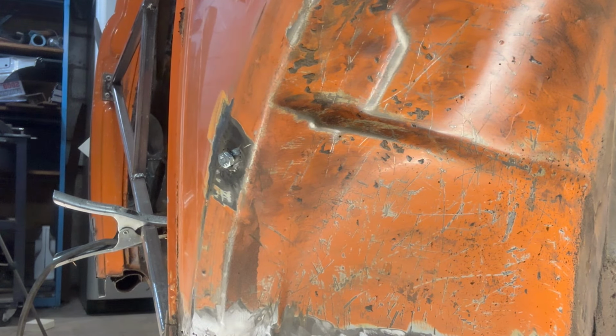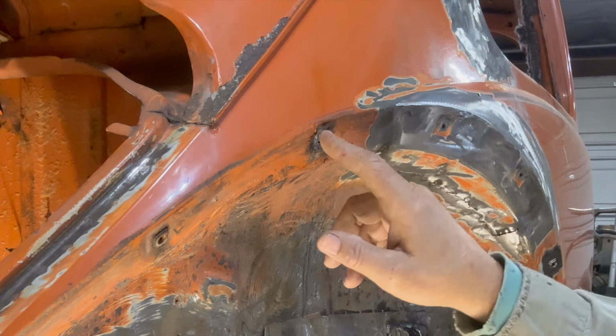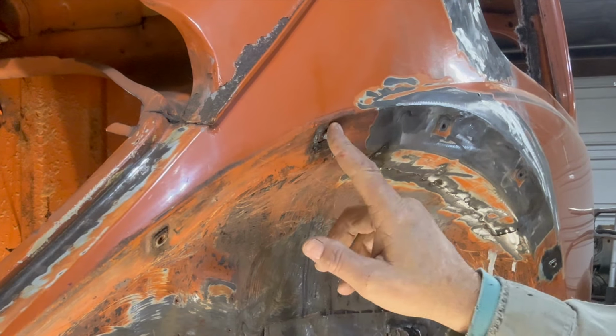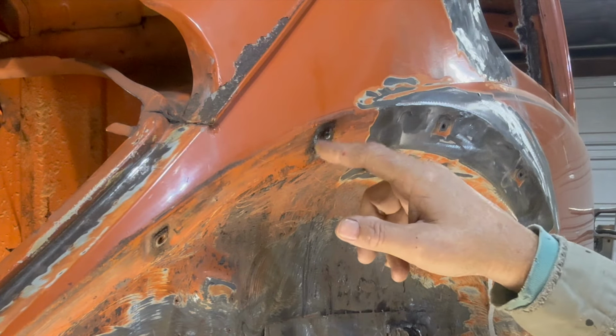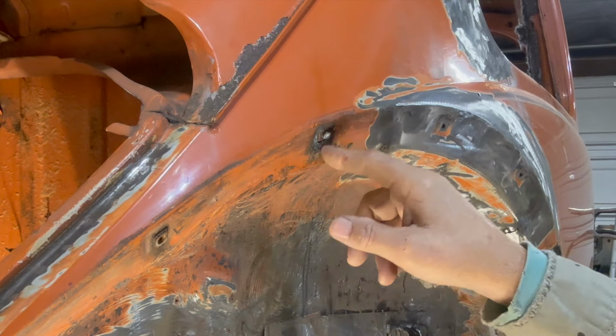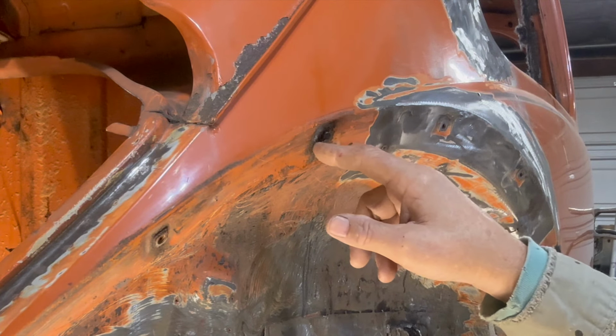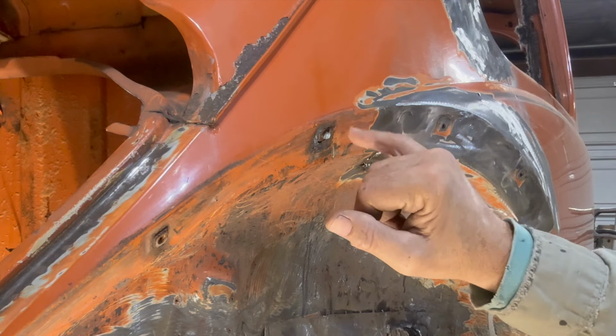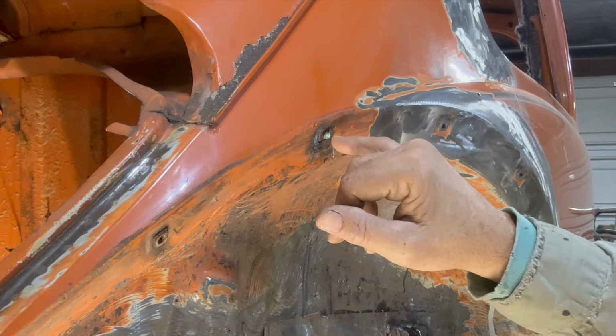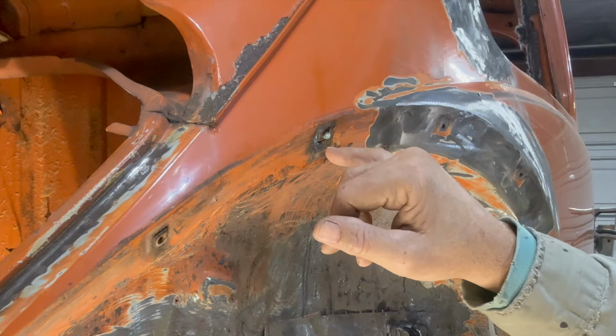We're going to do one more. I have one more, and we're going to try that one. A little different than this one. Okay, with this one, we got something altogether different. It broke off, and the nut is a little shaky on there, so we're going to clean it up with the wire brush, tack the nut a couple times, and then we're going to weld the nut onto this little piece that's hanging out and hope that that'll help extract the broken bolt.